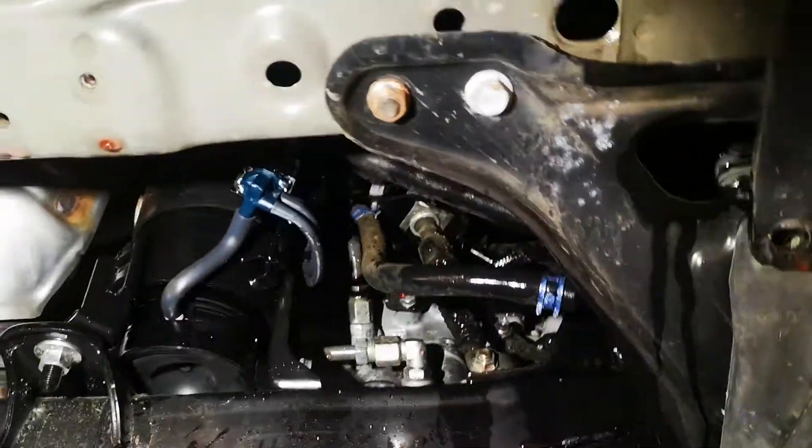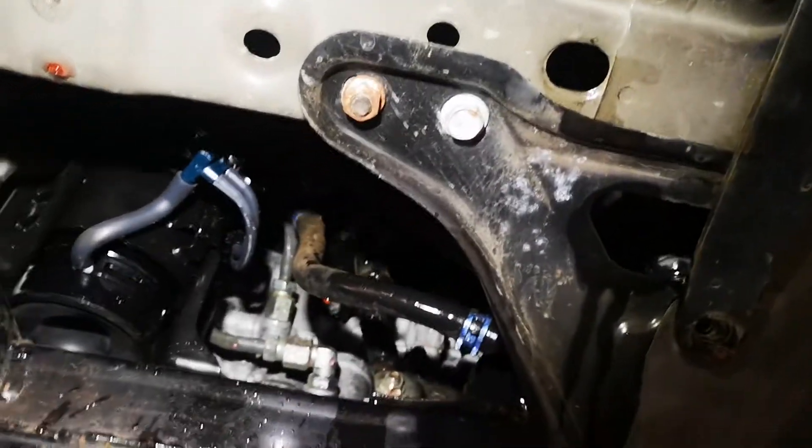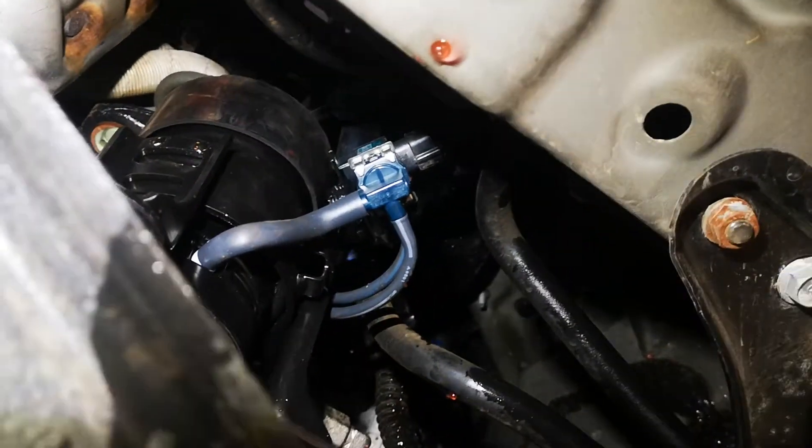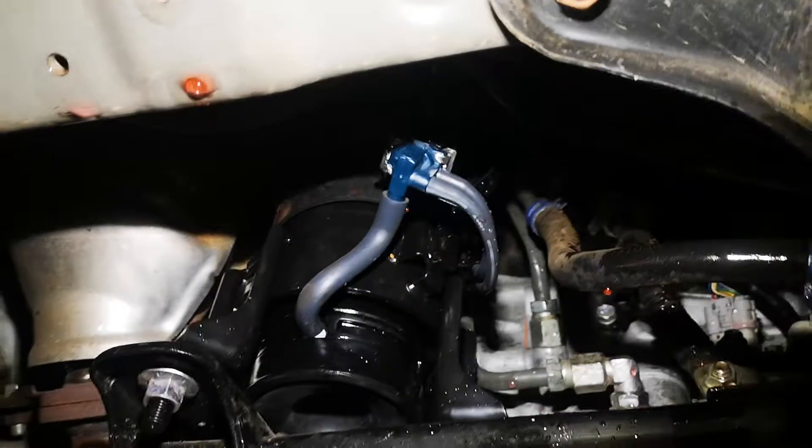What is meant to be done is refill it, run it, turn the heater controls on, get all the coolant out, and make sure you fill the right coolant in. Just because it's red doesn't mean it's the right coolant. This Kluger is a 2008.